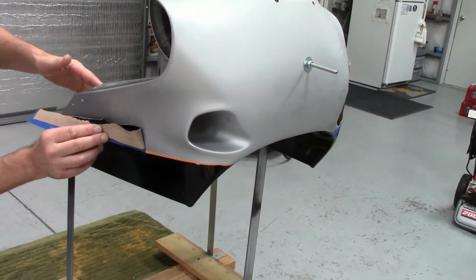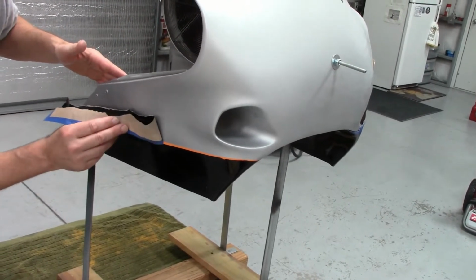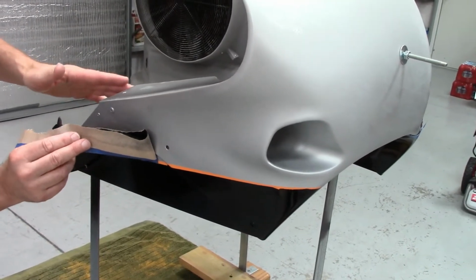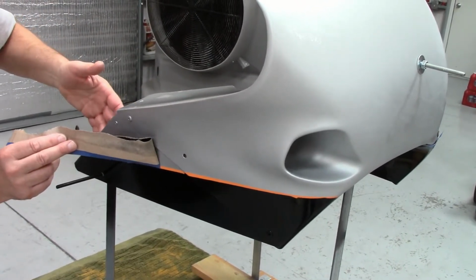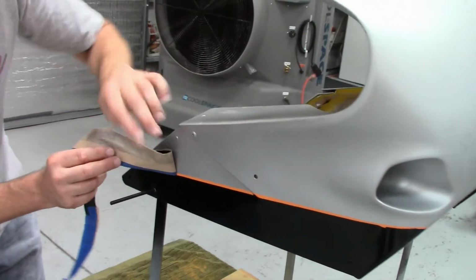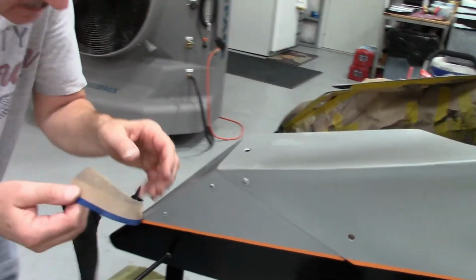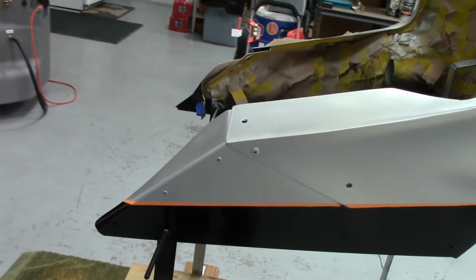So even with this, you want to pull it like I'm pulling it, not straight up. Pull the tape off at an angle. I go past 90 degrees a little, like this. Okay, so that's on the tape. That's still good. See, that's the beauty of the acrylic lacquer. It's about 30 minutes. Okay, then across my little stripe. So that's pretty good.